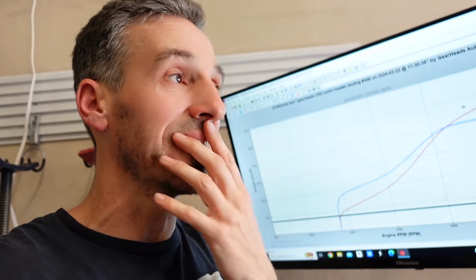And also, I'm on a clutch that probably can only handle maybe 500 torque because it started to slip at about 470 wheel torque. So I really didn't want that massive torque in the middle. I just wanted it to come on smooth and pull hard to redline. And now I finally have it. This is really exciting. I'm about to go look at the boost.